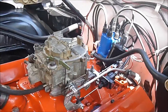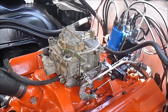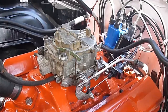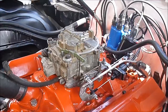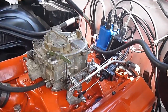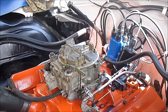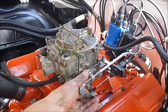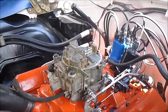I actually rebuilt this carburetor as part of a test I had to pass — the carburetor section of auto mechanics years ago. Yes, we had to do carburetors back then. This thing was last run about 21 years ago but it still seems to be in good shape. The floats still look okay when I quickly unscrew the top, and the gaskets are still supple. I remember it was hooked up to a 350 Oldsmobile or Chevy on a test stand — it started right up and ran. So hopefully it's still going to run nice when we try it out now. We'll see what happens.